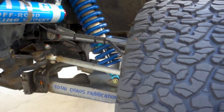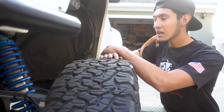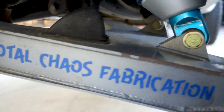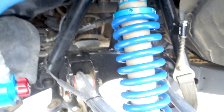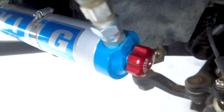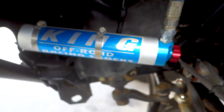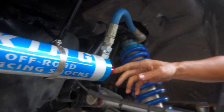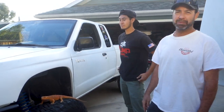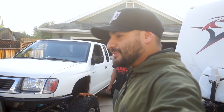As far as I know these kits are now extinct. You'd have to get with Total Chaos and see if they still have some. This is a first-gen, right? Yeah, the 2000. This is a first-gen Frontier — this is the only kit I had ever seen for this thing. So two-wheel drive truck — what is this, like 14 inches of travel? Yeah, 14 front and back right now. So we got the tubular upper — pretty standard with Total Chaos — get the beefier bushings, and then you get the box lower. And it's cool that you're running just the single coilover — is this like an 8-inch? Yeah, it's an 8-inch coil, it's actually a 2.5 coilover. And then you're running a nice little remote reservoir. This adjuster came with a small resi, it didn't have an adjuster before, but now it has this adjuster, longer resi, so you can go softer or firmer. All four shocks rebuilt and redone from Shock Prep Unlimited in Riverside.